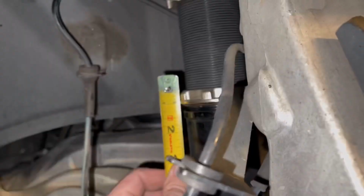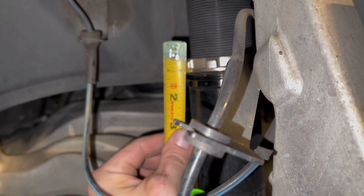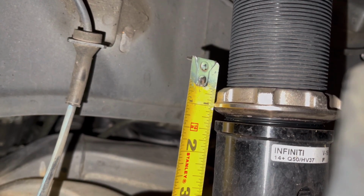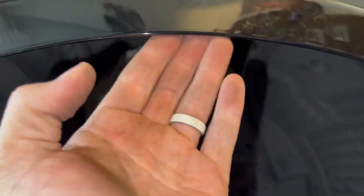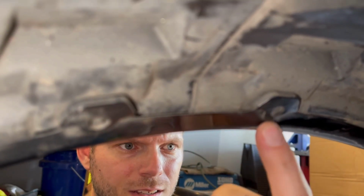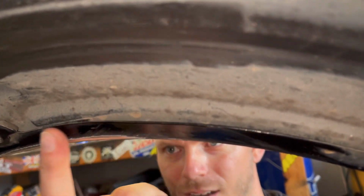The front is a concern, so I'm going up about a 1/4 inch, lip to lip. That should give us enough clearance, I hope, where we don't rub here, but it still keeps a nice gap. There you can definitely see some evidence of rubbing right in this area, and right there, a little wearing on that clip. Definitely pushed it in right in this region.